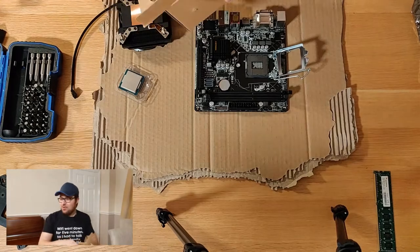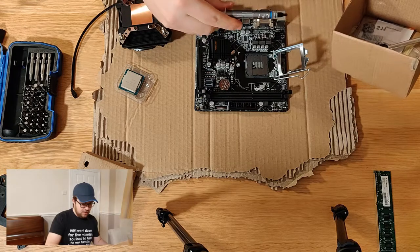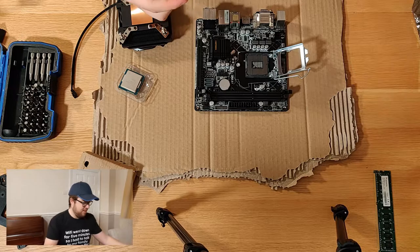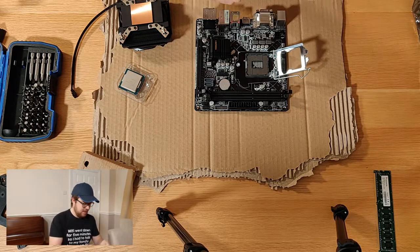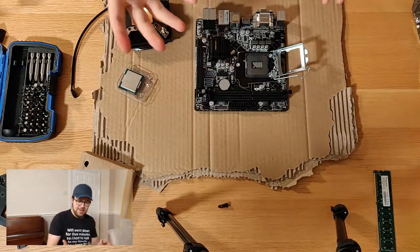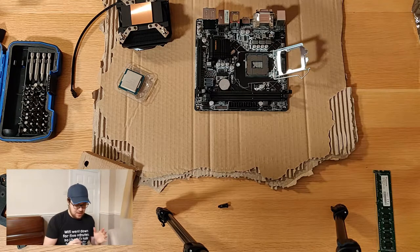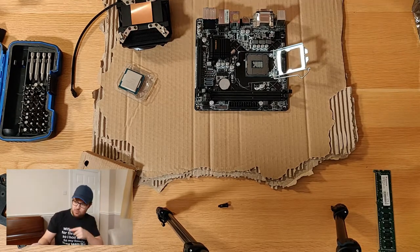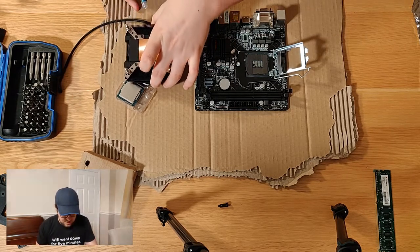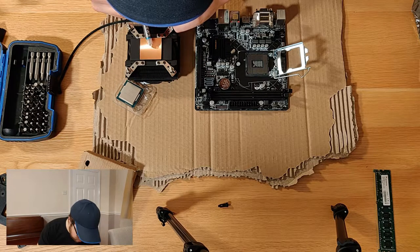Right, in the box, it came with some thermal compound. So, fairly basic stuff. High-density cryo paste. Well, it'll do, whatever it is. Better than nothing. What I like to do is, when I first put this on, try to do this with clean hands, by the way, because if you've got oil or any sort of grease on your hands at all, you might end up with hot spots on the CPU, which isn't pretty. I like to put just a little bit. I don't know if you can see this. I might zoom in the video when I actually show you. I'll put a little tiny spot.